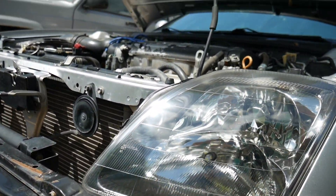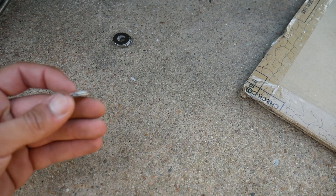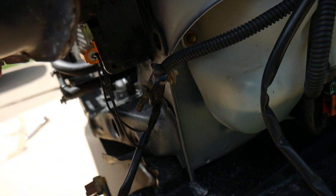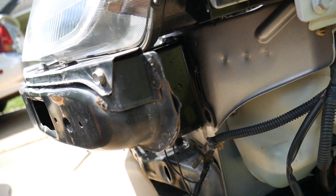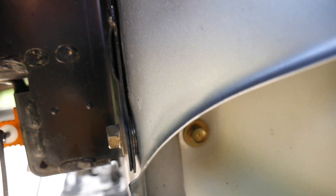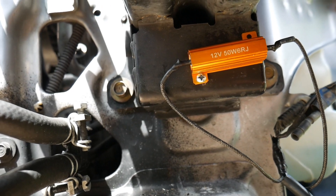What you're going to do is get eight washers — two washers on each lower bolt. Just stack them up and it's going to offset the bar so there's a space in between, and that pushes the bumper up, getting rid of the bumper sag. After that it should look exactly like that — two washers back there just offsetting it a tiny bit. Then just tighten it all up.